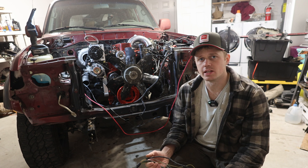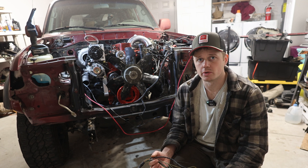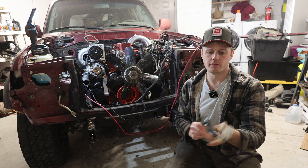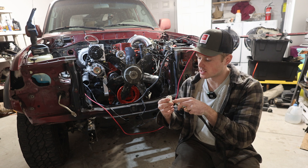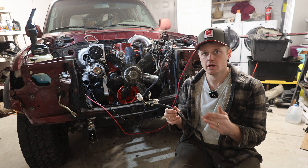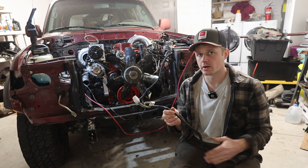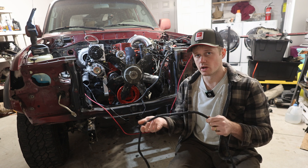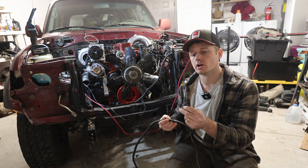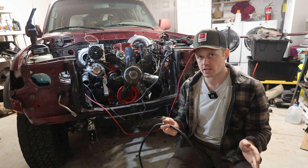We took a hot wire from the ignition coil that would have gone to the igniter for the 1FZ spark plugs. With a volt meter I confirmed 12 volts at key-on position, so we extended that wire back around the injection pump — now we have 12 volts going to the injection pump with the key on. We also extended the starter wire from the back of the harness. The thicker wire is for the park/neutral safety switch, which provides a hot wire to the starter only when the transmission is in neutral or park. We ran a hot wire from the park/neutral safety switch on the back of the connector into a spade connector that goes to the starter solenoid. We were able to turn the engine on and off with the key — exactly what we wanted.